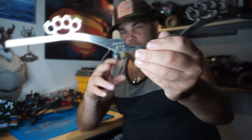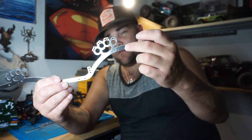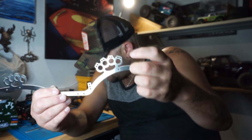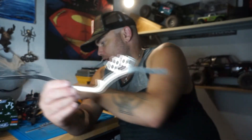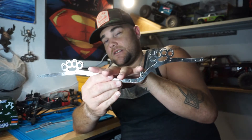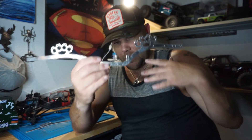Back axle — if I want to go short, bring it right in. If I want to go long, I can go all the way back to there. Plenty of things. Right there I'll have my Panhard mount, so I'll mount it there. I'm going to mount the AR-45s, see how I like the look. But I really think Capra axles underneath of this would just bring that ultimate comp crawler look that I'm wanting to go for.